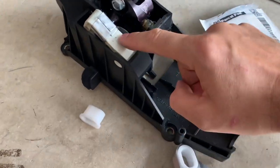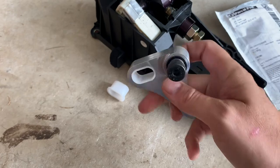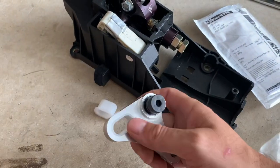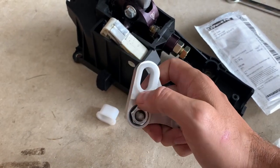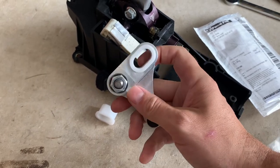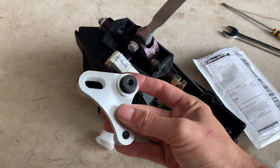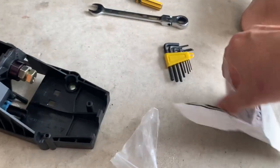So to replace this piece here, we have a machined piece of metal, and instead of the plastic peg that goes through, we now have a bolt. In the middle is Delrin - a machinable heavy piece of nylon - that the ball of the shifter goes into. That will have almost no play whatsoever.